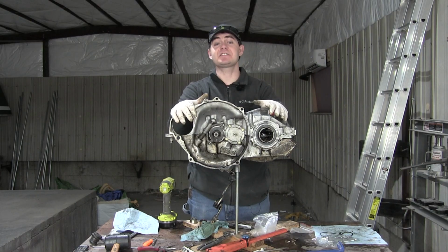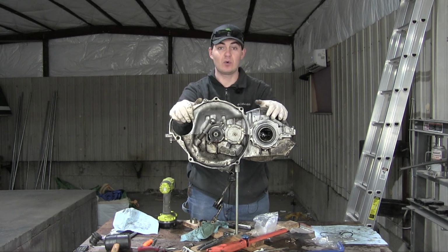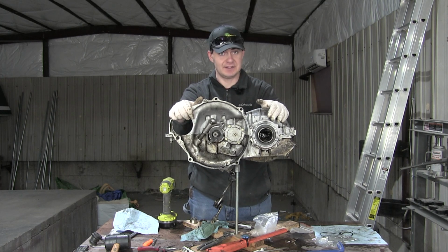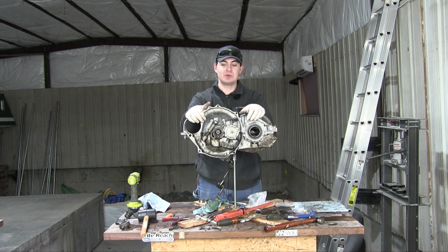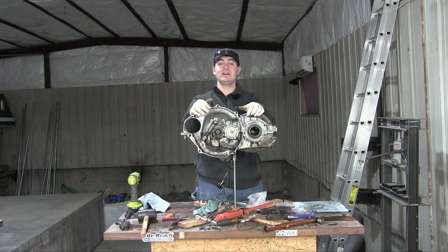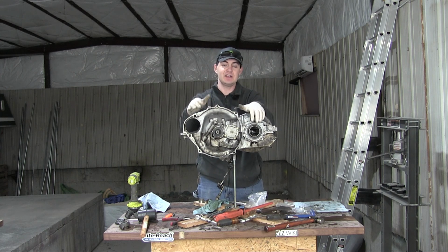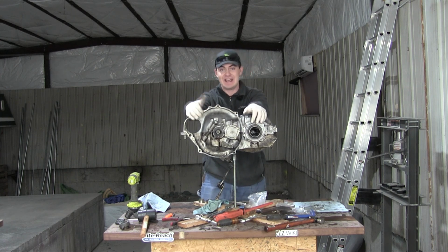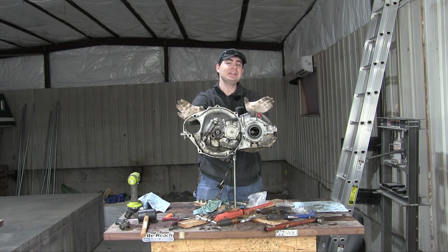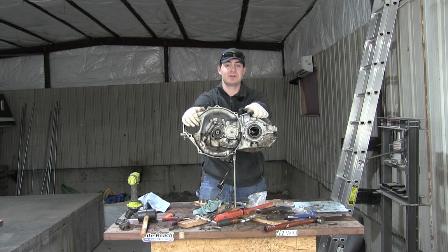And here it is. The gearbox is fully reassembled and nearly ready for action. Hopefully now I won't have any leaking, grinding, or not working problems with this transmission. Now, let's talk about gearbox oil. The proper and recommended gearbox oil to put in a Trabant gearbox is HLP 68 oil that can be found in Germany. Now, I've ordered this stuff from Germany before, had it shipped to the United States, and put it in this very gearbox. But this time around, when I ordered parts and the gearbox oil, I got an email a couple of days later saying, no, we can't ship any form of liquid to the United States. Customs will think it's a bomb or something. So they canceled my order of the gearbox oil.